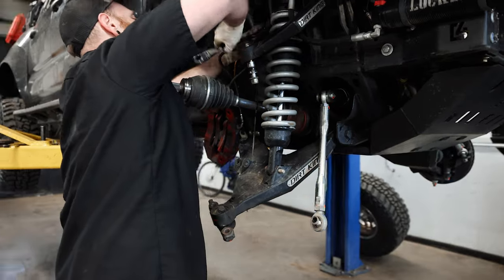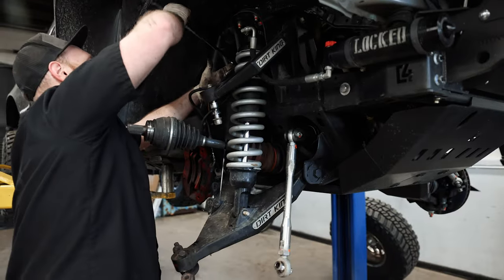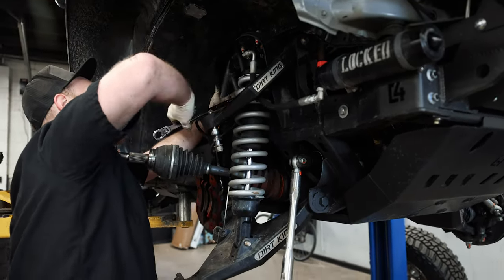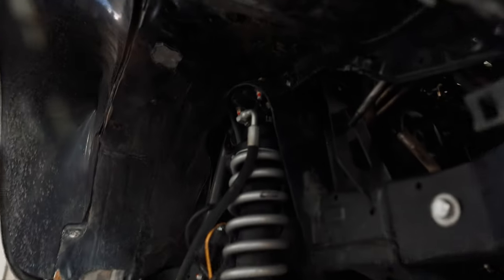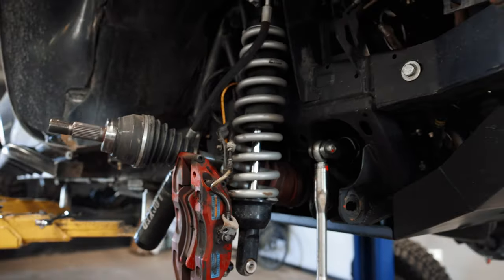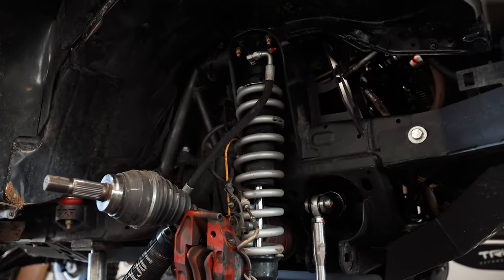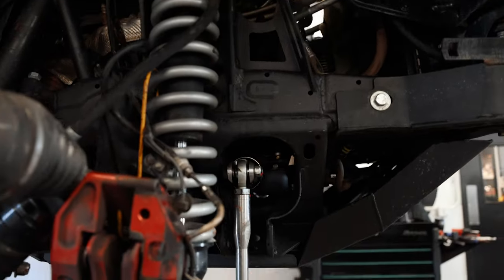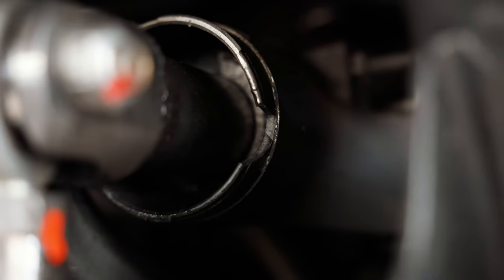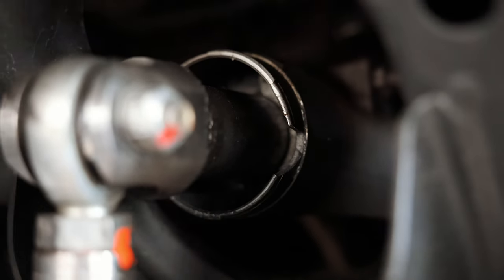As you guys can see, spindle and brake and everything is off. Now Billy is removing the upper control arms. We'll remove the lower and the shock and pull everything out, and then do the same on that side. Billy is flying through this. Next is remove this lock shock, and we're gonna swap out the spring cup and the rod end for the Marlin Crawler kit, and this side will be pretty much ready to go back together once we get this old steering rack removed. You guys can see in there how it self-clearanced itself and is leaking now, so good stuff.